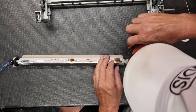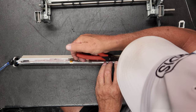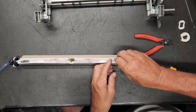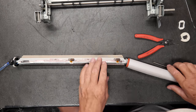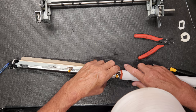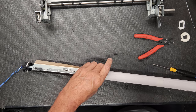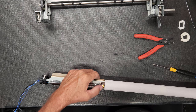This is your thermal sensor, and this rides up on the inside of this heat sleeve. And if it doesn't make good contact on that heat sleeve, you are going to get an SC code, or not an SC code, I'm thinking RICO. You're going to get an error code on this for a fuser problem. So that was kind of good that I did that, I guess.